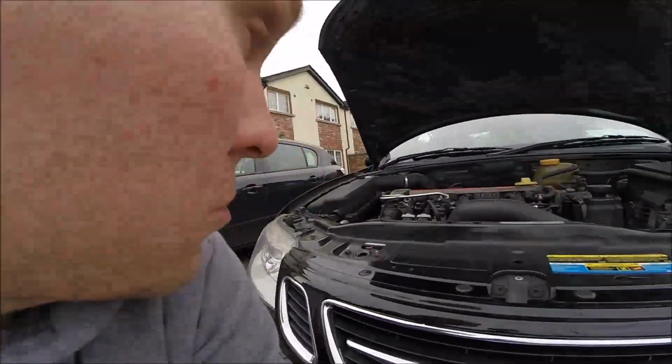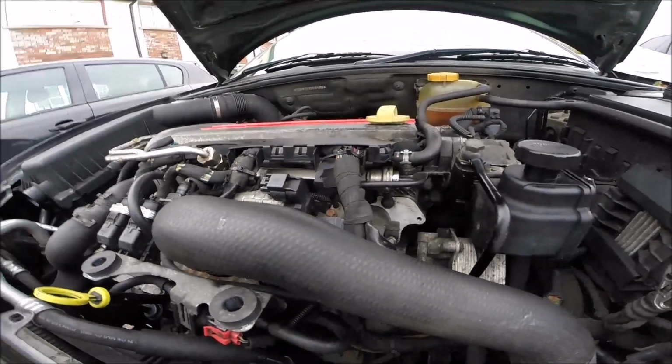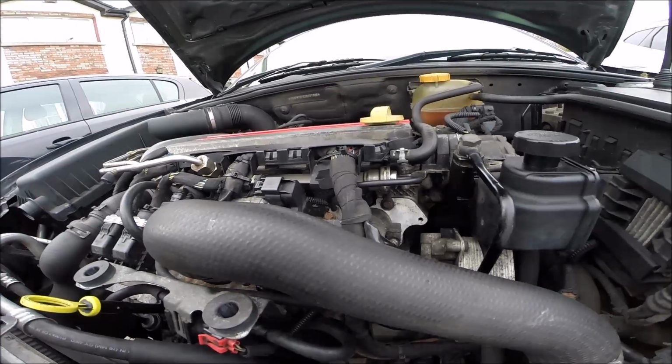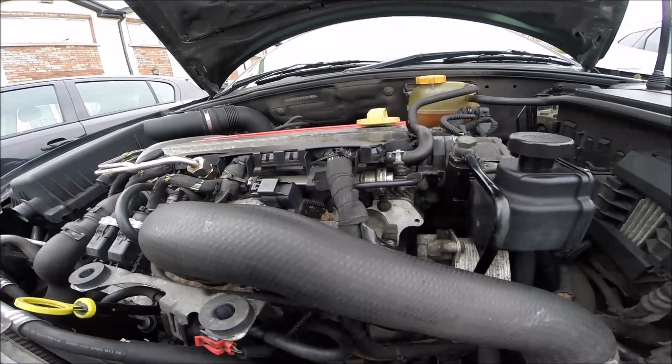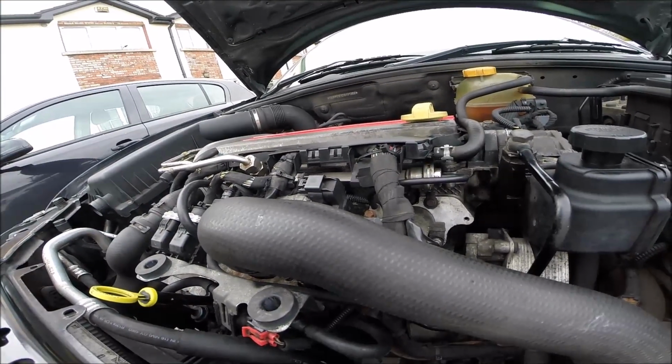The weather is beautiful today, very warm. That's warm, 13 degrees. So I stay outside the house and we try to remove the injectors to check the condition of the injector heads, because I'm still fighting with a little bit of misfiring, and the misfiring is on all cylinders.